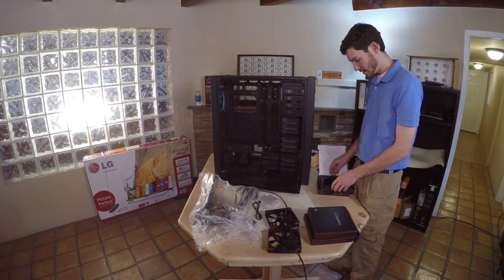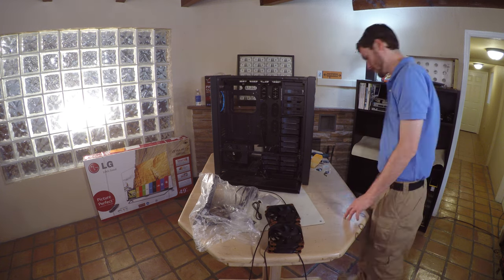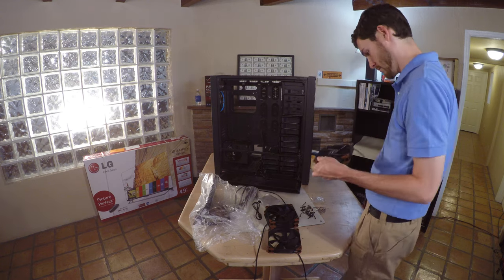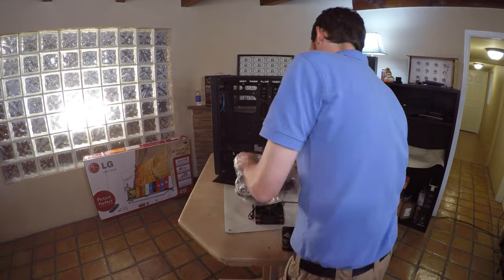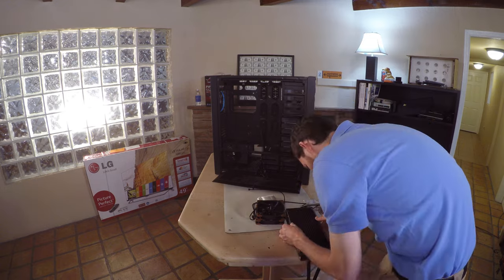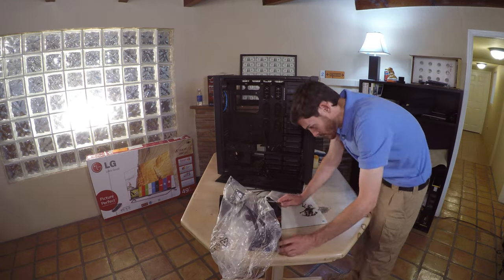Now that the fans are prepared, it's time to align your screws and hardware together so that way you have a successful installation when holding the radiator at the top of the case. The fan's power cables need to be oriented in a fashion that makes it easy to route them at the top of the case as well.